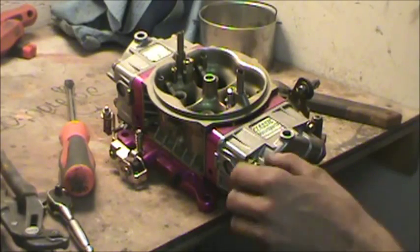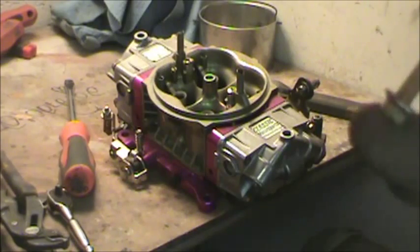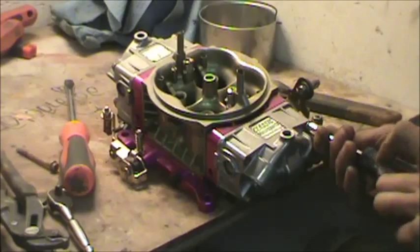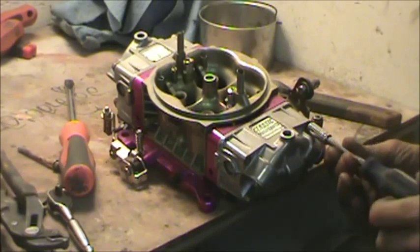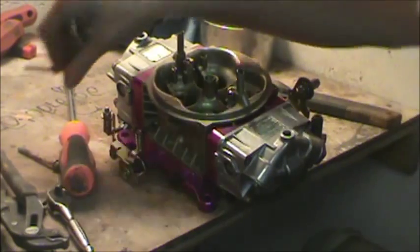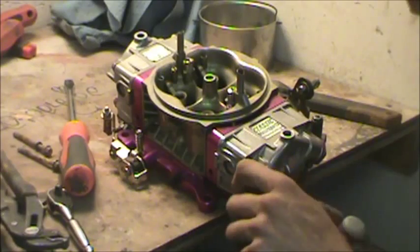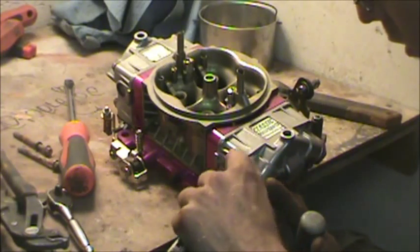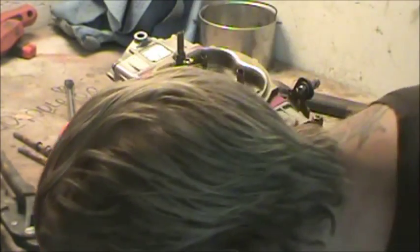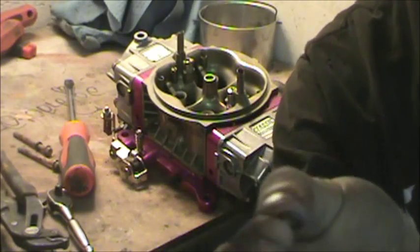You've got nylon washers here. Oh, lordy. That's what E85 does to steel, all right? We're gonna have to clean that up for sure. Is that a sign of something wrong inside? It could be. I'm not worried about saving these washers. I should have a replacement.